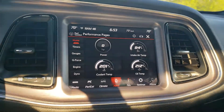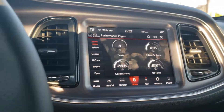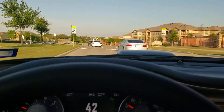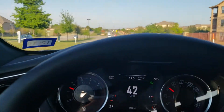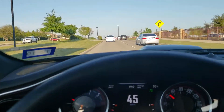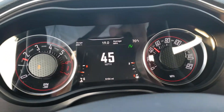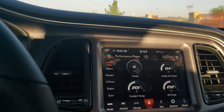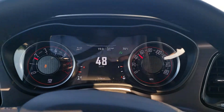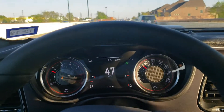We're back and as you can see we're at 84 degrees, still doing right around 40 miles an hour — that's pretty much where it's stabilized. It equates to just a couple of degrees difference. Normally you'd think more fresh air from outside the engine compartment means a lower intake air temperature, and that's not 100% true. We're only getting a couple of degrees drop, and we're also now at 70 degrees ambient, so that drop may partly be from the temperature change. It'll be interesting to see what the Hellcat headlight tube does.